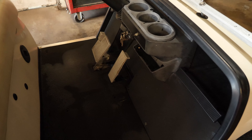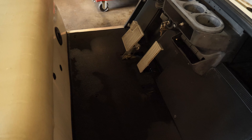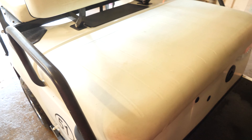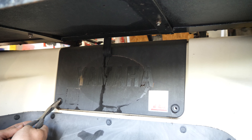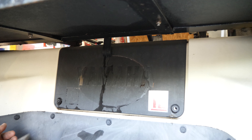The battery pack is good — I was able to get the charger to come on and it charged up as it normally does. So I'm thinking we either have a bad stop switch in the floor behind the pedal, or we have a bad solenoid. First thing we're going to check is the solenoid, because that's the most likely culprit. Let's get to that — we need to gain access here.